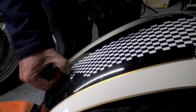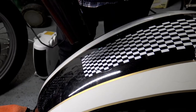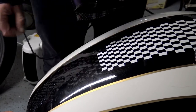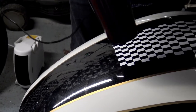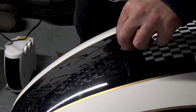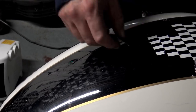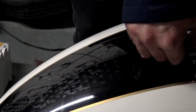Initially there is a little bit of trial and error in finding the correct temperature to remove these decals. The best way of removing them is to use your fingernails — I certainly wouldn't advise using any form of implement to scrape them off, not even a plastic scraper, as you are likely to cause scratches. If you get the temperature just right you'll find they peel off really easily and leave very little residue behind. This job was an absolute nightmare because all of the decals were individual. Work through it methodically, take your time, and don't try to rush it. And don't forget when you've finished to put the HD02 back exactly as it was.